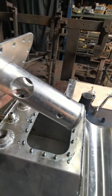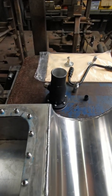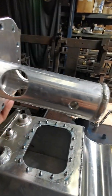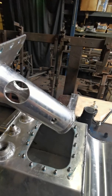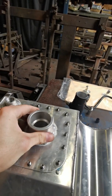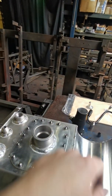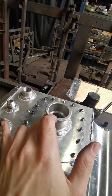The other one I had to make was a built-in check valve or rollover ball for the main filler neck — just in case it managed to find its way out of the filler cap itself. So I machined one of these which has an all-in-one big stainless ball in it, again with a couple of holes for filling. I tested the flow and I can't seem to top it at all — I tested it at my kitchen sink tap on full blast and I could not get past that top hole. So I welded a cap on the bottom with a little o-ring on there to stop it bouncing around, and then that will connect to the bottom side of the fuel filler neck.